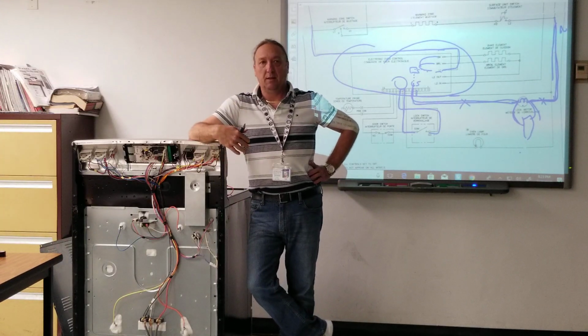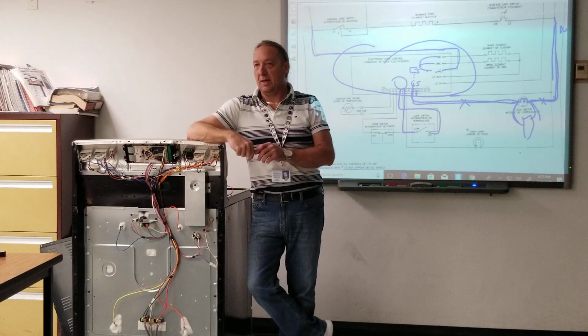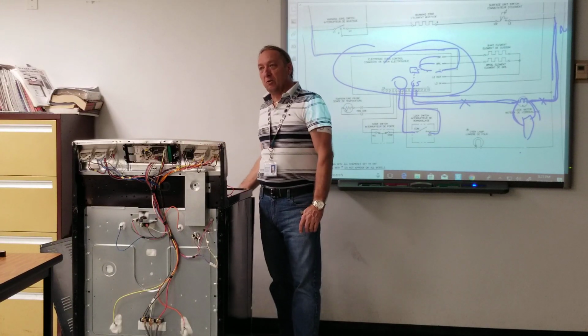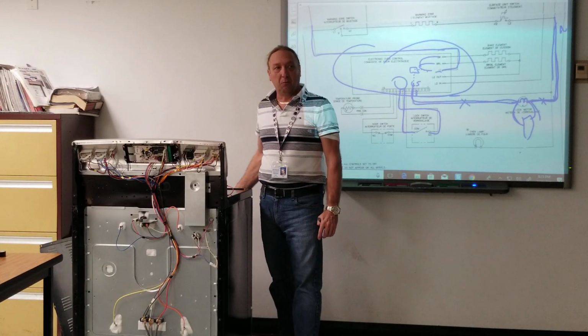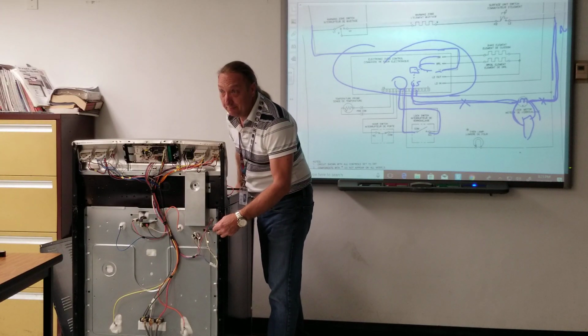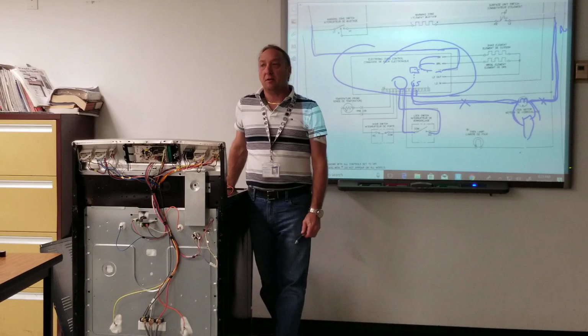It wasn't like, oh man, it could be this, it could be that. Yes, the door switch: if you open and close the door, if that switch was bad, the motor would not run. But if that door switch was bad, what would happen? You'd see the light on all the time. The light would stay on.